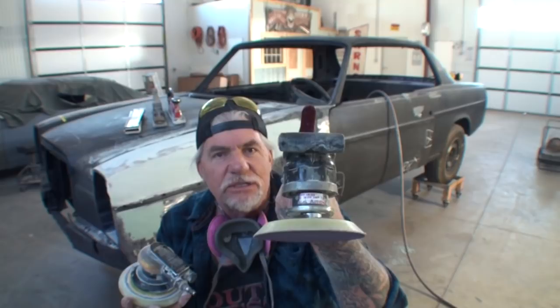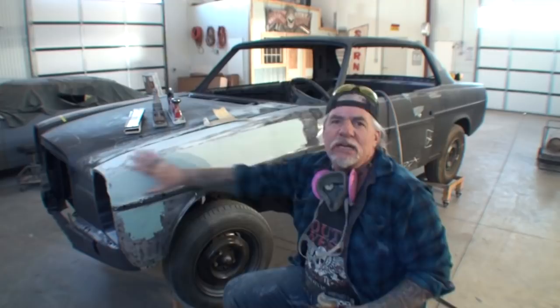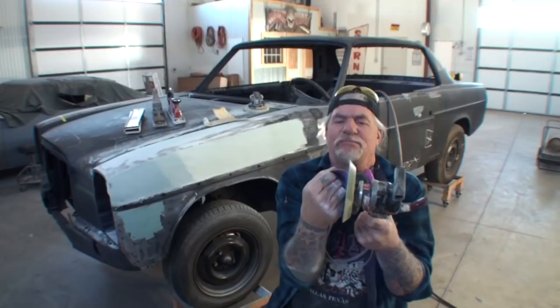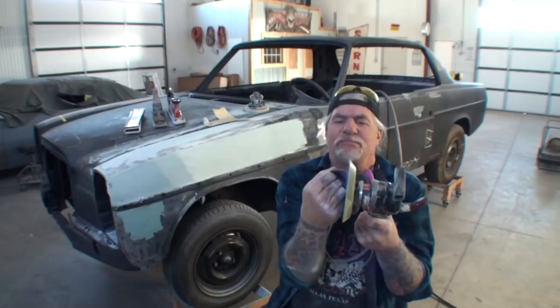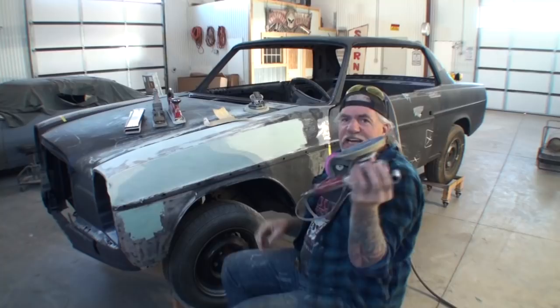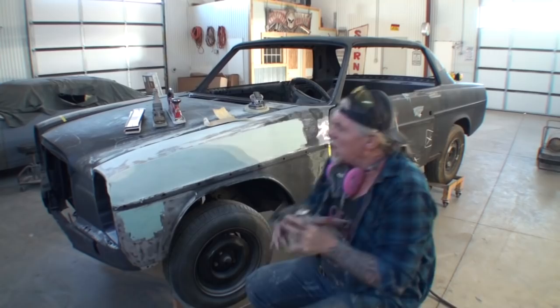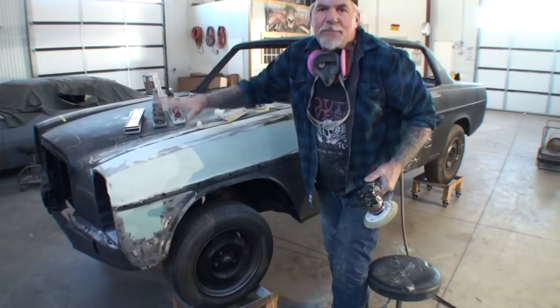This long throw DA is also going to do this job right here. When I say this job, I'm breaking down my first layer of Bondo. I'm going to take my long throw, pull off the 80 grit, put a piece of 36 grit on there, and form and mold my bodywork with the long throw DA sander. Once I've got all my bodywork done, I can put 180 grit on and quickly go over it to get all the deep scratches out — and it is primer ready.